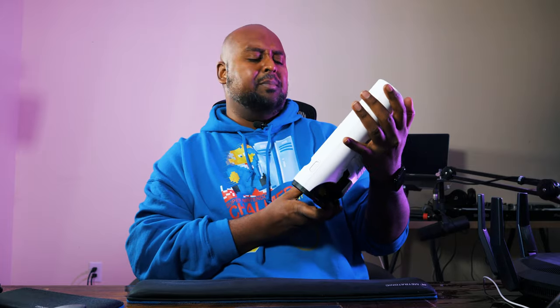Let's go over why you typically don't want to use your ISP-provided router/modem to route your traffic. Number one: Wi-Fi speeds on these things are usually abysmal — this one's not terrible, but it leaves room to be desired. ISP-provided equipment tends to lock out certain features or omit them entirely, mainly for diagnostic reasons. Also, the main processor inside the ISP's equipment is usually not high-end — they cut costs, and you pay for it in lack of performance.